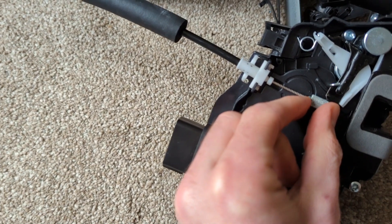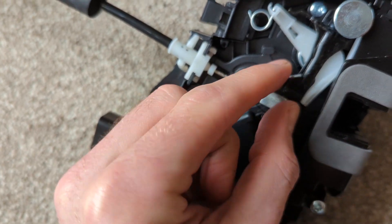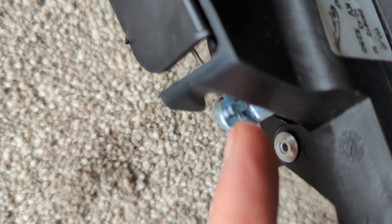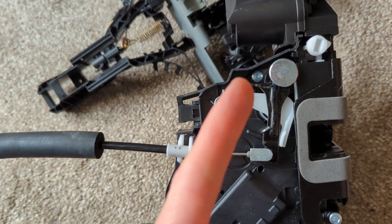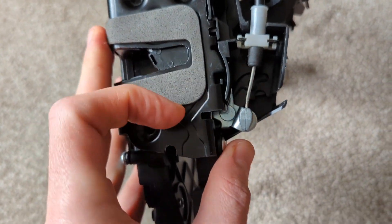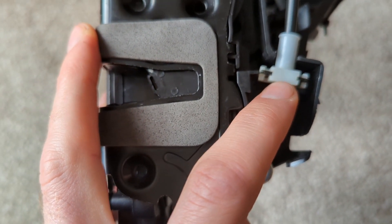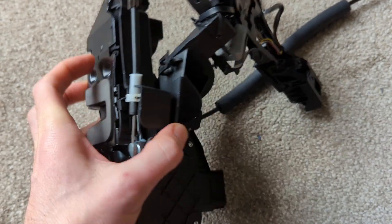Once you've released that cable, you can turn this round and see where the little notch is on the black piece. The silver piece sort of moves round clockwise, and that then makes it free and easy to release. On the back side you can see the end of the cable has got a rectangular sort of shape which goes into the rectangular hole — but it won't do that until the cable has been moved upwards. That cable also needs to be turned clockwise to release it from the little bracket. This one seemed a little bit more complicated because there are actually four little pins holding that bracket on. Just take your time with a little flat blade screwdriver and gently bring them up — I used a magnifying glass as well just to make sure I wasn't putting unnecessary force on it. Take your time getting those out so you don't break any pins.